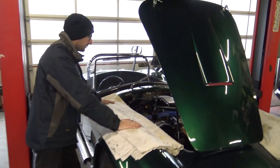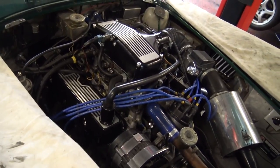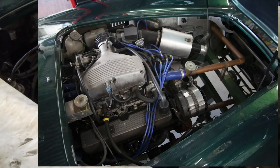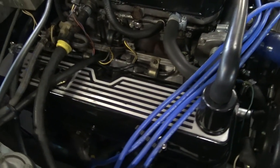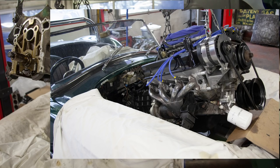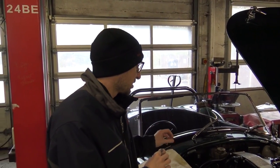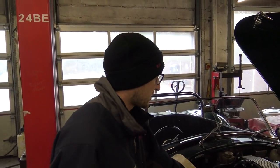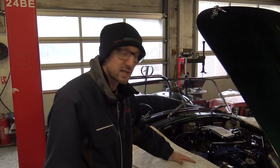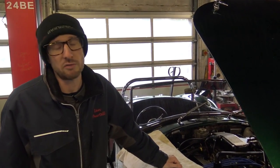Over to the Cobra. Steve's got a couple of photos - this is the engine back in. Steve should be splicing a video of how the engine did look. We spent a lot of time and detail on the rocker covers and plenum chamber just to give it a really nice look. As previously stated, this has changed from the LT77 to the R380 gearbox. We just need to create a new rear mount for the gearbox - other than that this is done. Road testing will be beginning of next year. We've only got a couple of days left this year, so both these green vehicles - the MG and the Cobra - we'll be doing a road test video, which should be our first workshop update next year.